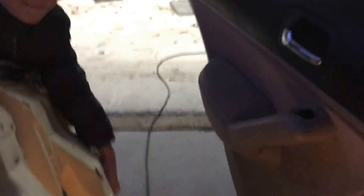Alright, now I have the seat out — I'm gonna hand it to my assistant. Okay, take the seat. Now that we have the seat out, you're gonna find additional hooks on both sides of the rear seat right there, and those are the same — they're gonna have 10-millimeter bolts holding these seats together.